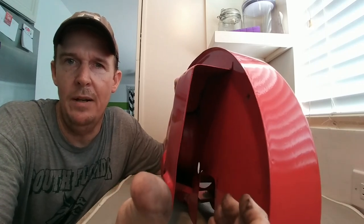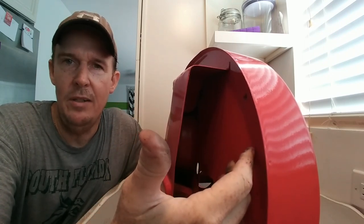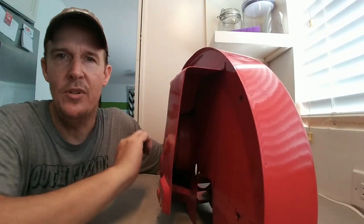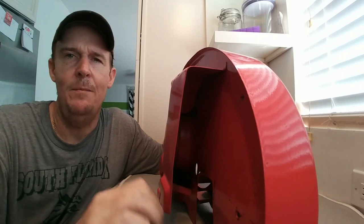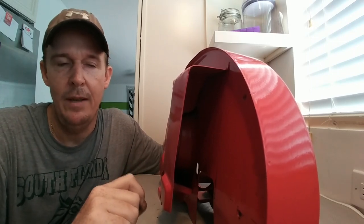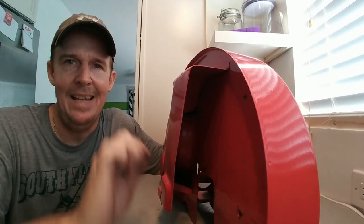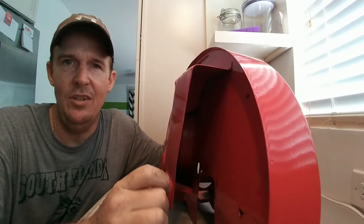When the fan is spinning, air goes across those fins, gets blown through the oil cooler. The oil cooler is like a radiator, to put it in simple layman's terms. It gets pushed through there to keep the engine oil as cool as possible. That's why it's very important in the classic Volkswagen to make sure everything has all its proper seals and engine tins — there's a reason why they're there.